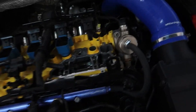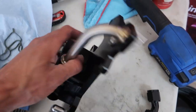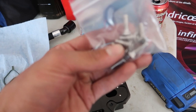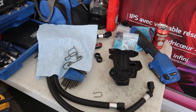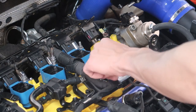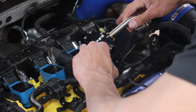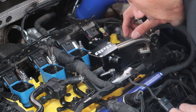If you have a catch can plate on there, obviously that needs to come off first. I got my Racing Line one off, got the gasket out, I'm gonna wipe down the sealing surface really good, wipe down the gasket, slip it onto the new one, and clean off this surface as well. Then we'll slap it on, put the new screws in — I'll probably wind up painting them black depending on how it looks. It doesn't come with instructions or a torque value. Someone said on the big MQB Facebook pages it would come with a gasket — don't know why it didn't.